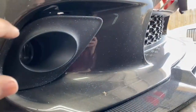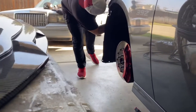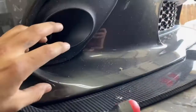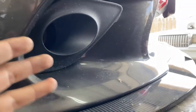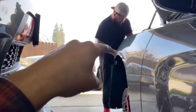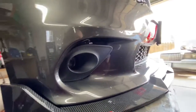Hey, what temperature? Temperature for the headlights? Temperature for the headlights, 245. For 245, yeah, about 10-15 minutes. So that's the temperature you want to have the oven set to, and how long you want to keep the headlights inside there. That way the adhesive and the seals are cracked and removed easily, rather than having to apply too much pressure on the actual headlight. But back to the fog situation.